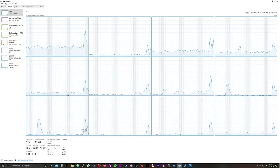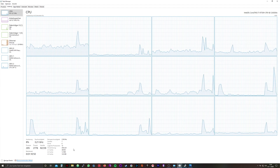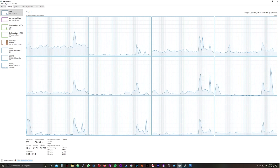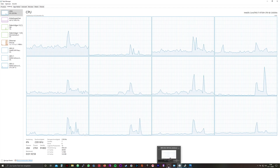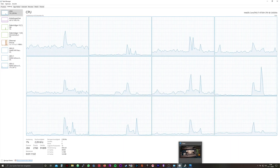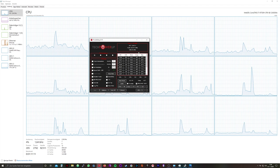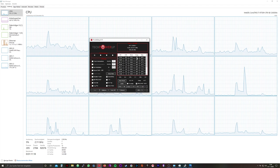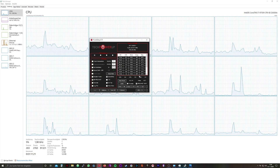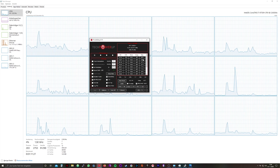You can already see it displays all the CPUs — six physical cores and six virtual ones, running at a rather high speed. It runs way better than the old system did. I think part of that is because this CPU generation doesn't care as much about temperature, so it throttles way later than the previous generation. At idle it's about 40 degrees, same as the old one, but it just handles higher temperatures much better.